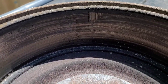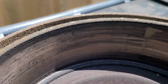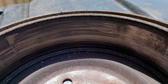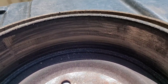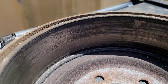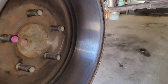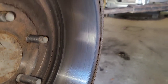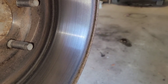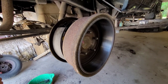The one drum on the right side has got a coating mixed between brake dust and brake fluid. What I'm going to do is clean that up with brake clean and a couple of rags, then use a Scotch-Brite pad and scour it down a little bit, brake clean it again and install it. I'm not cutting the drums or anything on this — it's just kind of a budget-friendly repair. And it looks a lot better. There's no reason to cut it; it didn't have any type of pulsation or vibration.